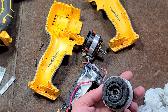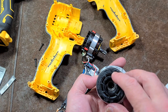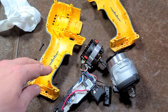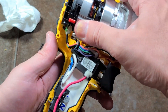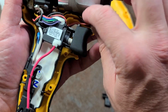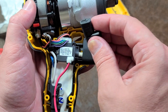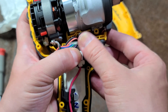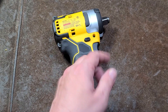I'm going to put a couple extra dabs of grease in here. Getting this back together — one quick tip: there are little cutouts to make clearance for the screws on the motor, so you'll want to get these half-moon notches aligned right with the center of the split posts on the gearbox. Then we just take the whole assembly and jam it together, and nestle it back into where it came from. Be careful with these little wires. You've got to fidget around until you get everything together, and then the last thing is that little switch. Make sure those little wires are running in their track — it really sucks to pinch those off. And there we are.